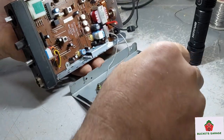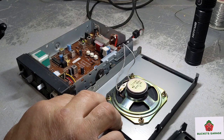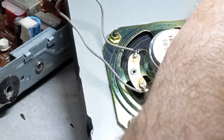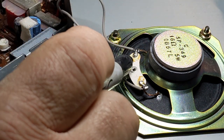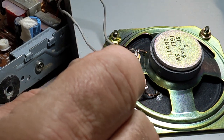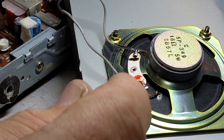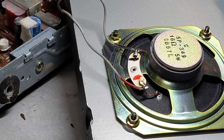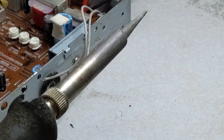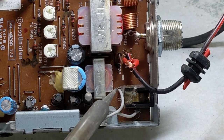First we're going to disconnect the speaker. Now what I like to do — because there is a positive and negative for the speaker — I'll do a little zoom here for you. It says negative right here on the speaker, and then you can see there's a positive. I take a black marker and mark that wire. If you want, you can even mark it on the speaker. Take a red pen, mark that wire red, and mark the red side on the speaker. But if you do lose your place, let's get these disconnected first. Now let's say you did take this all apart — pay attention to where your wire goes in. One wire is toward the back and the other one's toward your speaker jack.